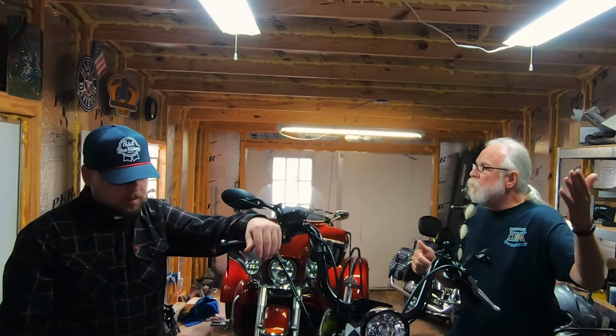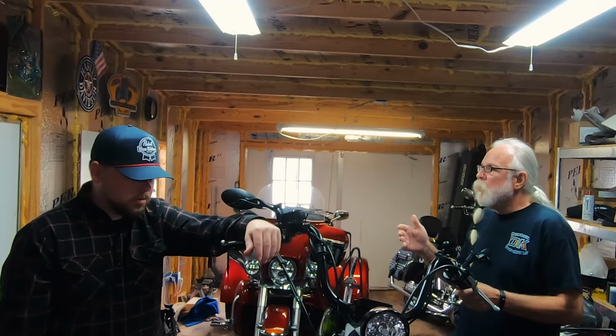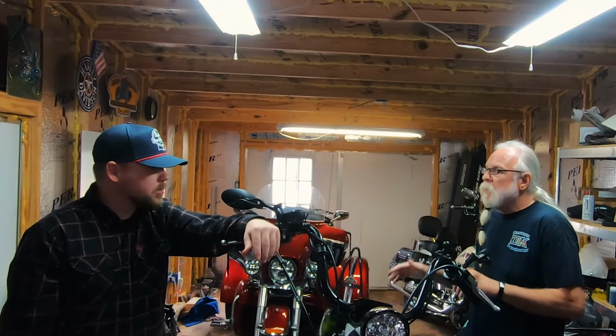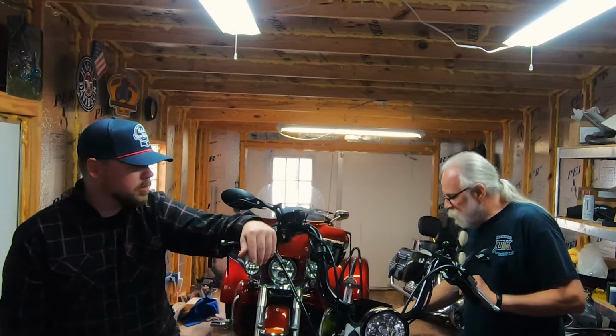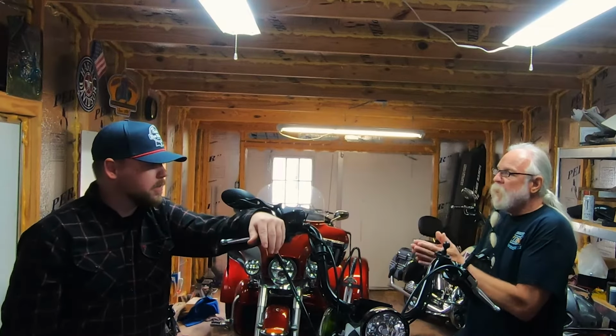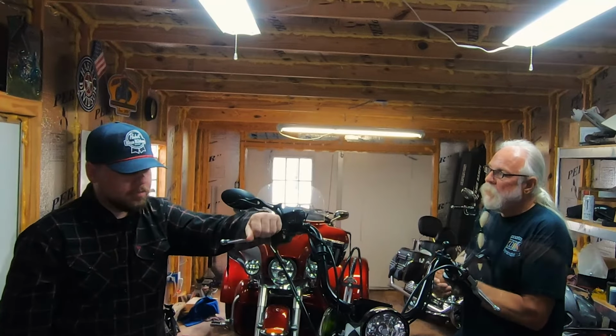We already looked at the AFR. The AFR was good. So we're not getting that increase in horsepower or torque while sacrificing the engine by getting too lean. So we already know we're not too lean, but we're getting more horsepower and more torque with the factory tune just by adding a high flow air cleaner.